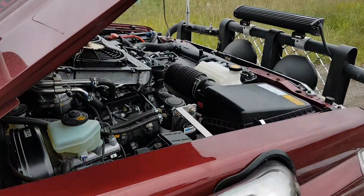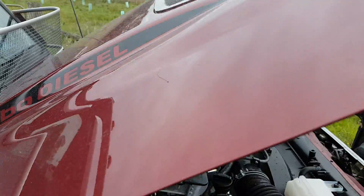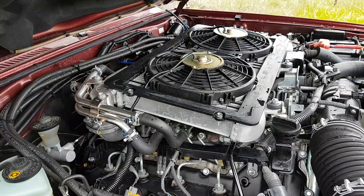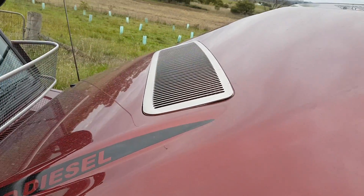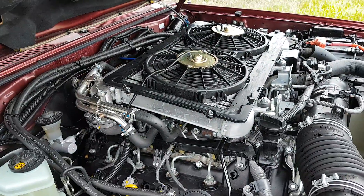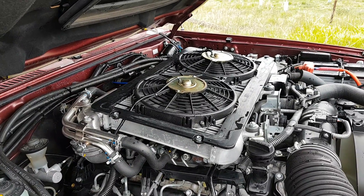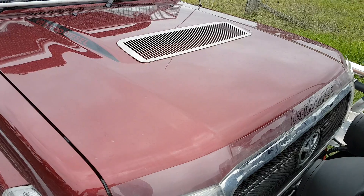The main reason I've done this is because so many guys are worried about things getting into the intercooler from the top, and in their haste to protect it they put covers on — which is fair enough — but it really takes away from the airflow. We already know the 70 series V8 struggles with airflow just from its design.